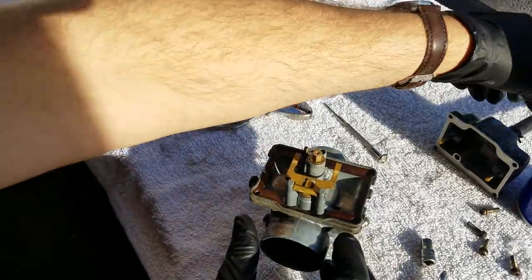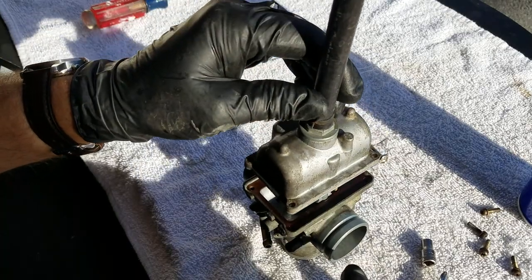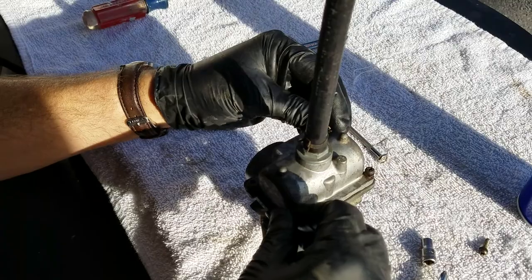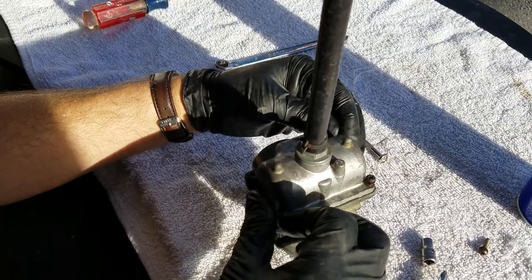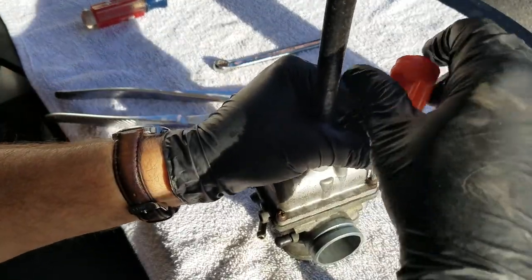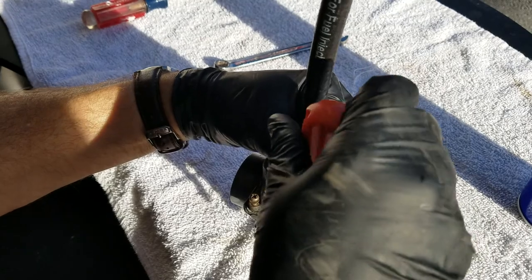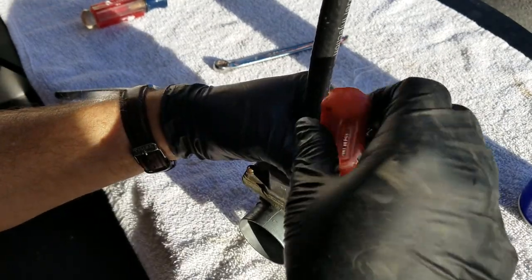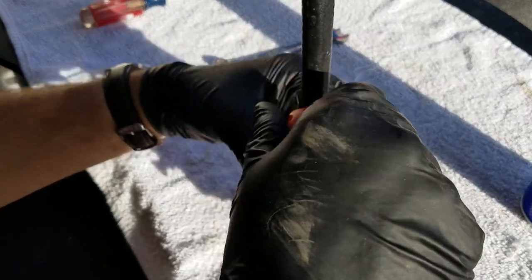This is in the proper position. I'm going to go ahead and reinsert the bowl — this is where it gets inserted into. Put it down very gently and put these screws back in. All four screws have compression washers. This is all aluminum and I really don't want to over-torque these screws — just get them good and snug and then go back through and tighten them up.